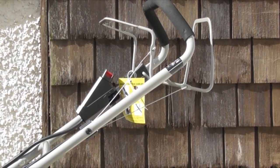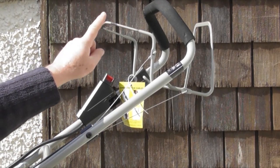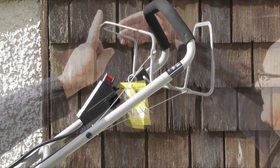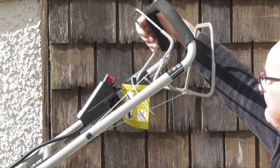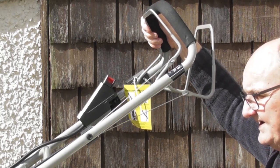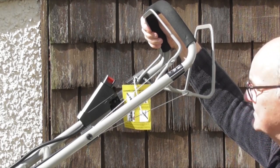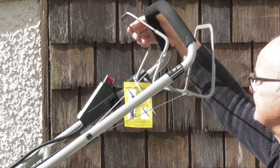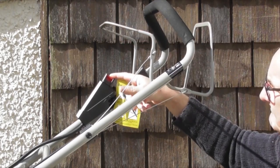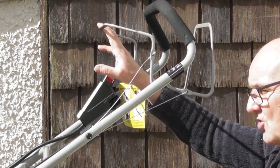Let's look at a few of the controls on your lawnmower. This front handle is the OPC lever, or Operator Present Control — basically an on-off switch. When you pull back the OPC lever, it enables the electric start function and removes the grounding from the spark plug, allowing the engine spark plug to work. When you release this lever, it kills the start function and the spark to the spark plug, thus stopping the engine.